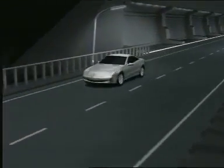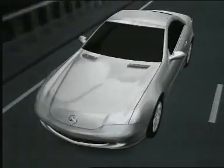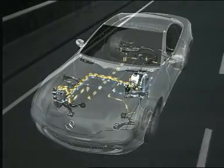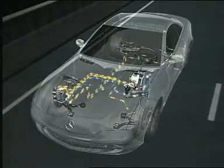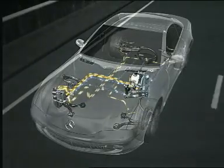Following electronic control systems such as ABS, ASR, ESP and brake assist, SBC marks a further revolutionary stage in brake technology. Unlike previous brake systems, SBC dispenses with the mechanical hydraulic coupling of the pedal and brake. This allows precise braking for increased vehicle safety.